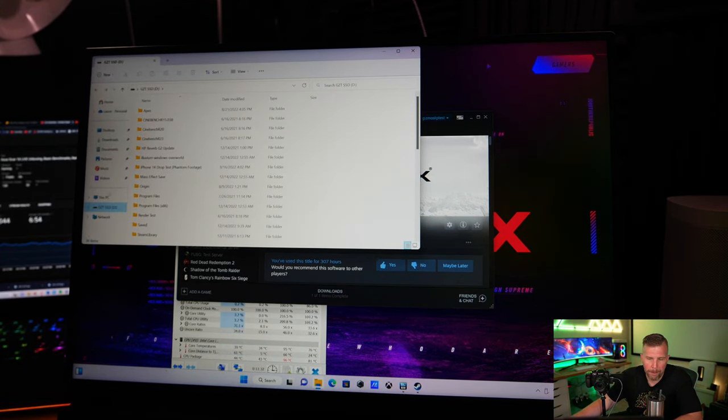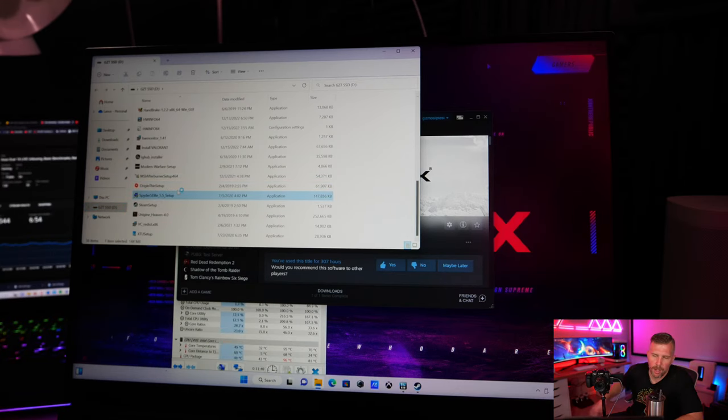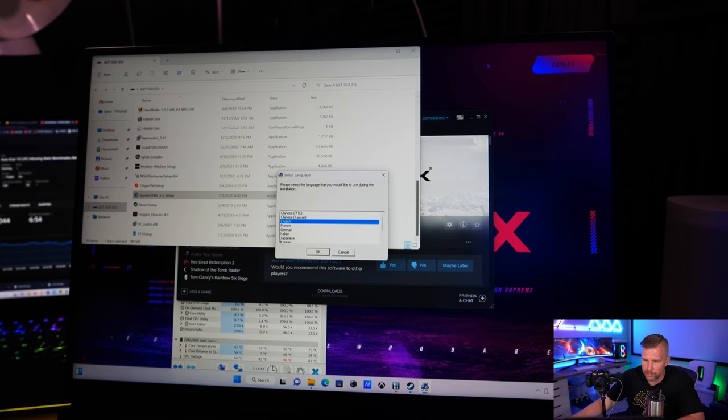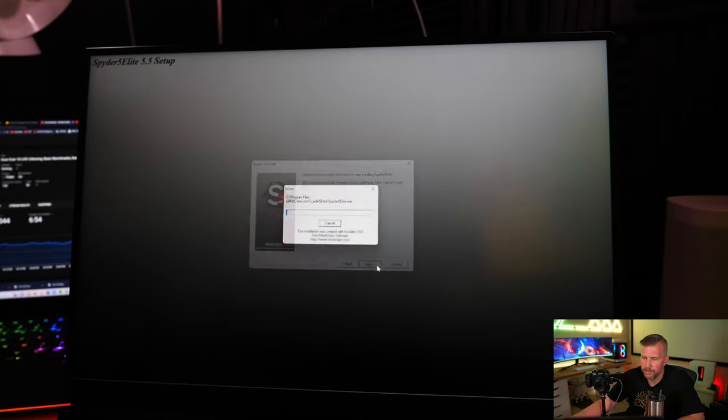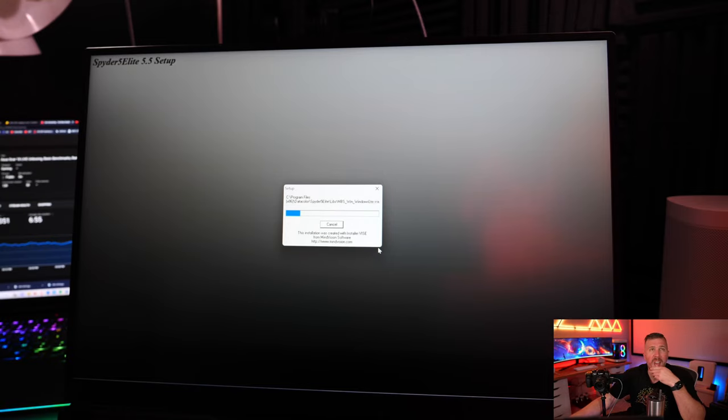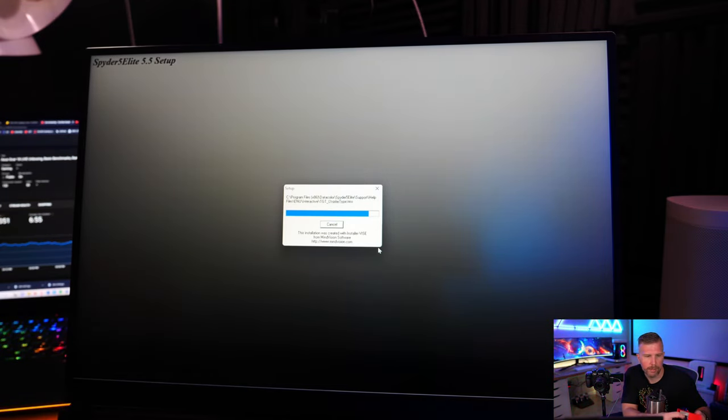Now this is supposed to be the same display as the Scar 18, but still, I want to do a test and see if there's much variance between the Scar 18 and this display. It should be at least within 50 nits of 500, and then hopefully we're getting around 90% Adobe RGB, 90% P3 color gamut with the Spyder 5, because that means that other tools will probably register that closer to 500 nits and at near 100% Adobe and P3 color gamuts.